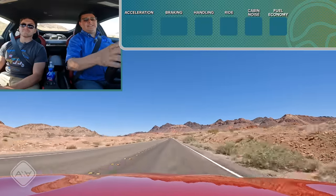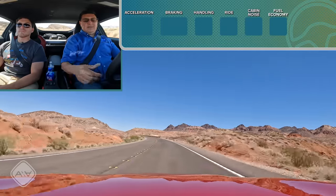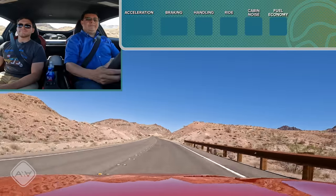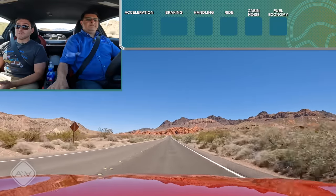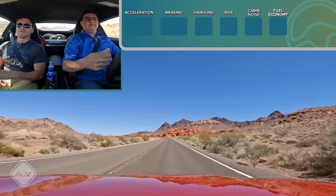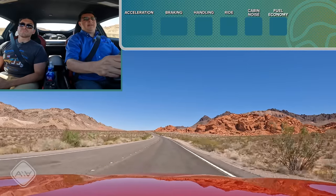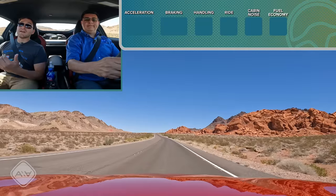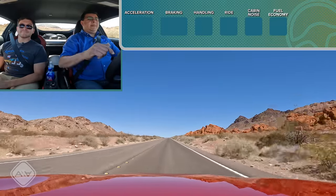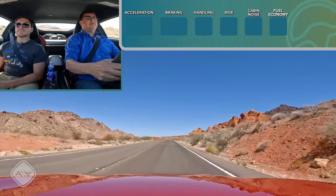The 9-speed automatic is going to be the fastest 0-60 every time. One annoying thing though — no easy access to the lowest gear available. If you're in manual mode, you have to click that paddle all the way down to whatever gear you want. If you're in ninth gear, I think that's kind of a bummer. Being that this is a derivative of a Mercedes-Benz transmission, you actually do feel a little bit of that inspiration — it's very quick shifting, and the ratios are really close together. It has a really great feel to it and is hands down the best automatic transmission that's ever been in a Nissan vehicle. It's also the same one that is in the Titan and the new Frontier. We don't have stopping distances just yet, but expect this to be a little bit shorter than the previous Z because we have about 20% more contact patch on those front wheels doing the majority of emergency braking — you can definitely feel that confident feel when you stab on the brakes.